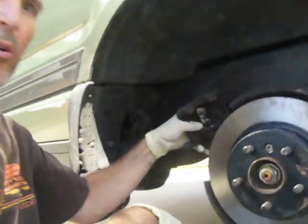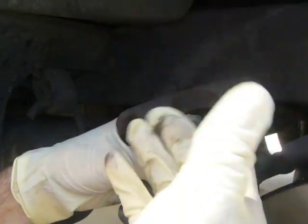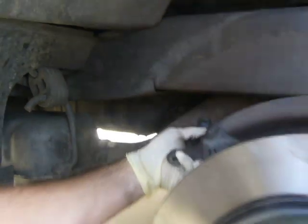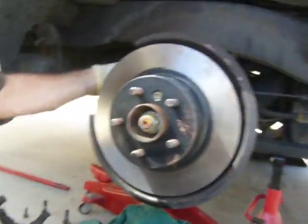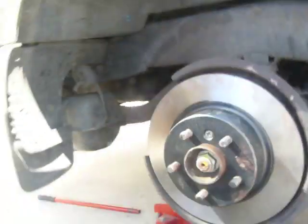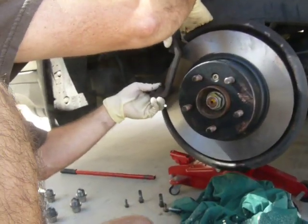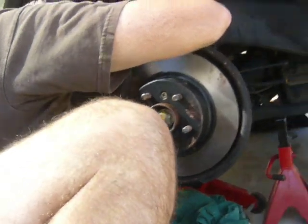Okay, I'll get it in there. Very good. We've got this flush because originally this is out. It pushes itself out as the brakes get thinner over time, right? So we set that back up in here. The first thing we need to do is remount the brake housing. That's going to sit right in here, just like this. And this is where the brakes like to sit.